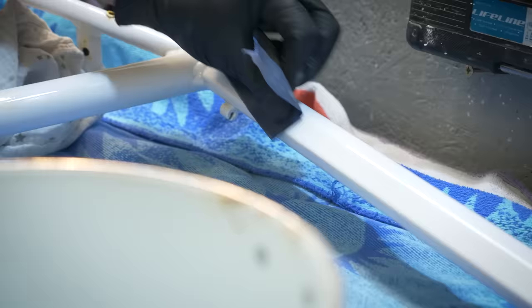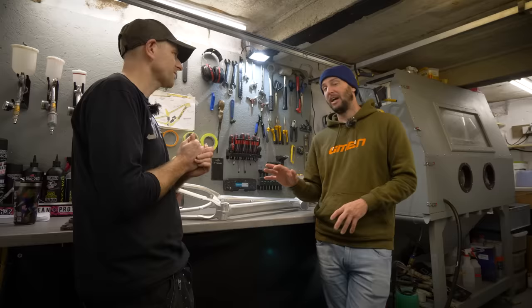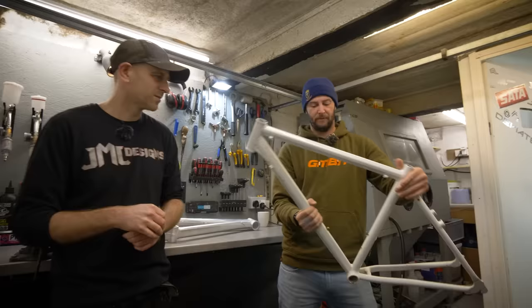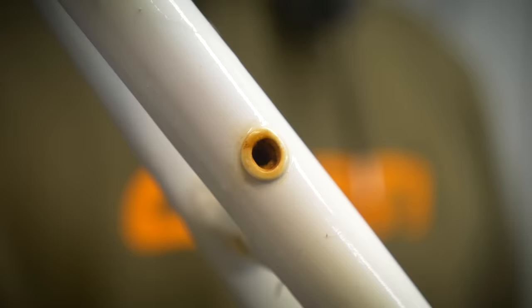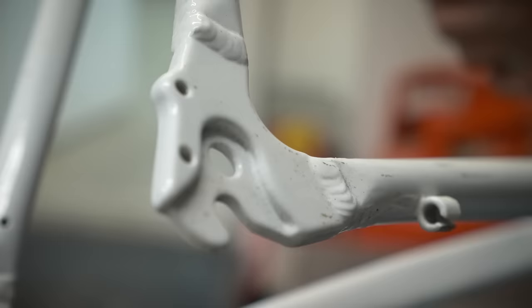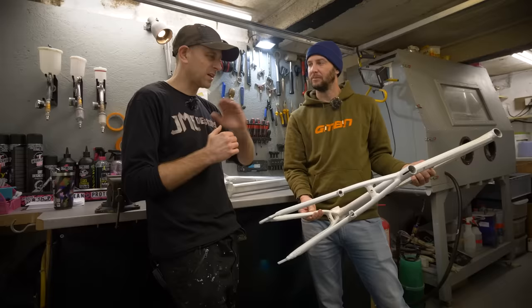Take all the greasy fingerprints off as well. You want to clean the fingerprints first and then sand it, because you don't want to be sanding them into the surface. A lot of people at home are going to have painted frames that they want to prep up. If I can just grab this one — this is a pretty standard hardtail frame, it's already painted, it's got bits of sticker on it. How would folks at home go about prepping something like this? Well, there are a few ways. You can sand it and prep it, make sure you sand off all the logos so you can get nice smooth paintwork, and take off all the stickers.